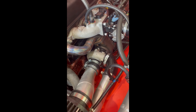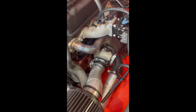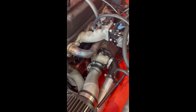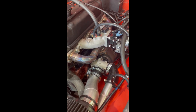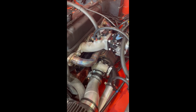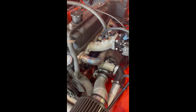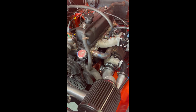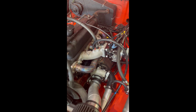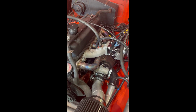The GBC 2300 will support well over 200 horsepower very easily — probably as much as 250 without too much stress. It's a very versatile turbo and a good size for the 1.8-litre, because it spools up at just over 2000-2200 RPM. You get a nice swell of torque from low in the rev range, which is what the MG needs — torque that just pushes along rather than needing to rev it hard for outright power.